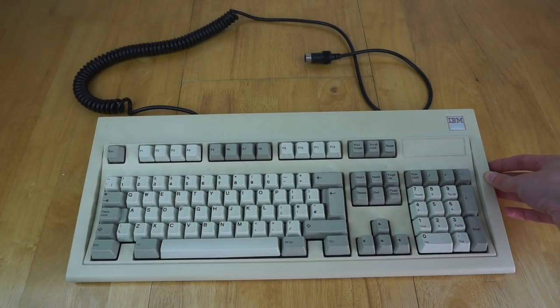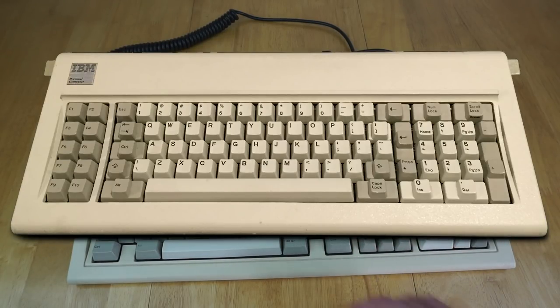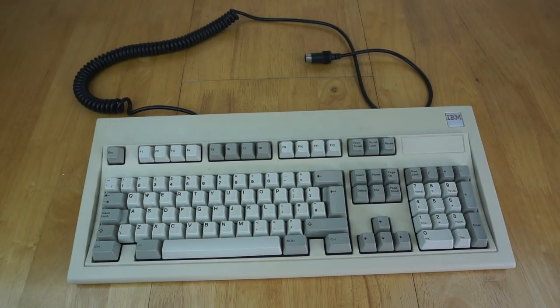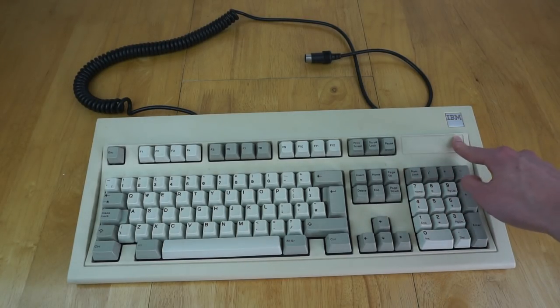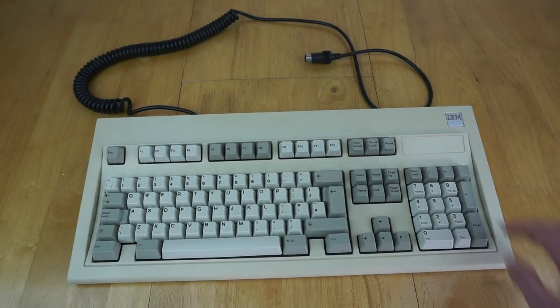You can see the monitor goes like an old TV — the whole picture sort of shoots to the middle. So the first bit of hardware we're going to look at is the keyboard. People who like their keyboards are probably instantly recognising this as an IBM Model M. This is actually one of the earliest Model M's made. Originally the IBM PC and the XT shipped with the Model F keyboard, which had a quite different layout — the function keys down the left, smaller keys, a completely different style, and internally a slightly different switch mechanism. However, later model XTs — from the late 1986 onwards — shipped with Model M's like this.